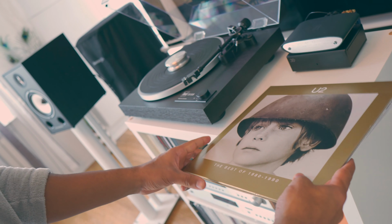This time I moved to another turntable, a Dual CS 518 fitted with the Denon DL103 moving coil cartridge, low gain. And this time we have to say goodbye to the Cambridge Audio Solo because that's only moving magnet. But we will meet it again at the conclusions. So an interesting test to see if they have enough power to handle a very low signal coming from the Denon DL103. And here I have to say that the AVM suffered a little bit.